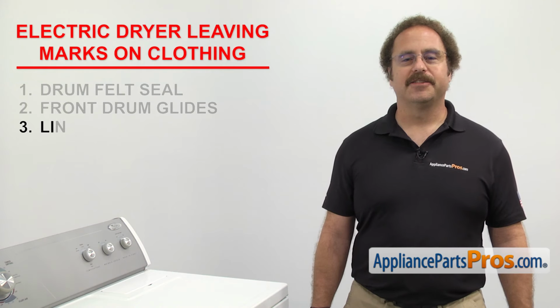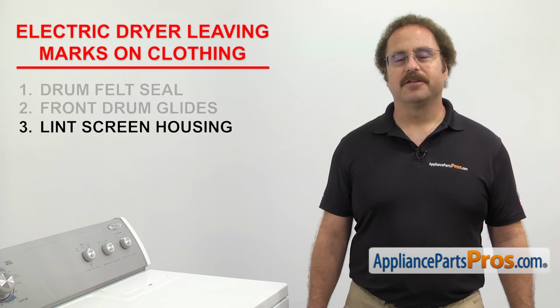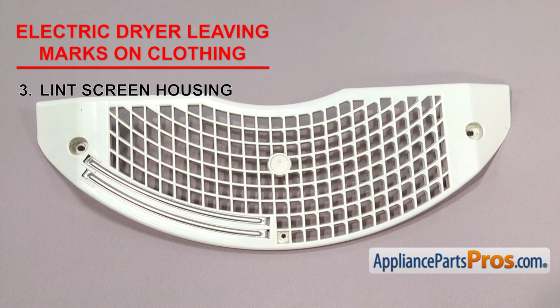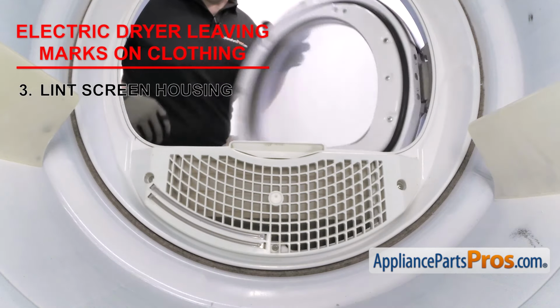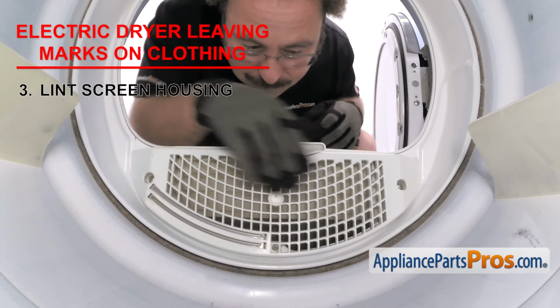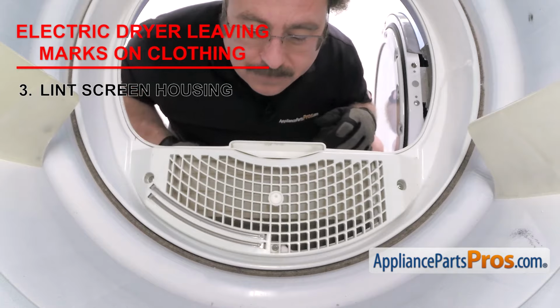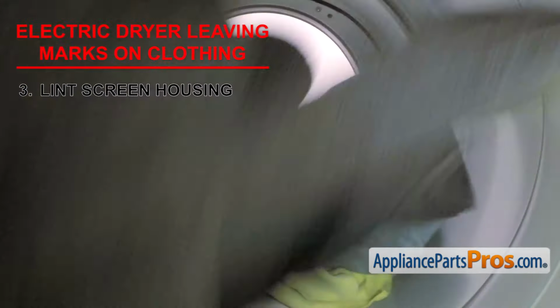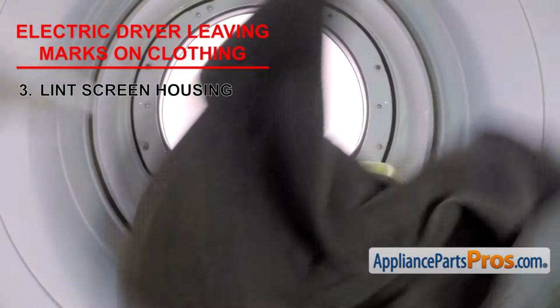Next, we need to check the lint screen housing. It allows the warm air to circulate through the lint screen. Lint screen housings are found on dryers where the lint screen is located inside the door. All you have to do is open up the door and inspect the housing. If it's cracked or damaged, it could be snagging the clothes as they tumble, leaving marks on them. If the housing is damaged, you'll need to replace it.